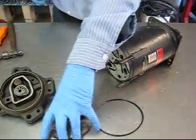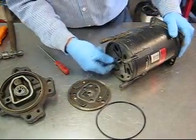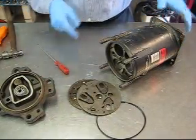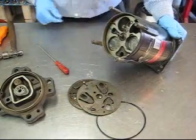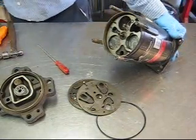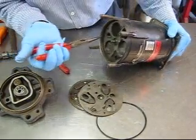This is the rear cylinder head seal, and this is the valve plate as well as the reed plate. There's an oil pump in an A6 — they retain their own oil, and that is found in the bottom. That oil pump tube has to be removed first, or you will damage the compressor or the oil pump tube trying to get it apart.